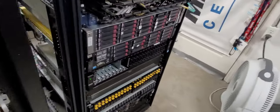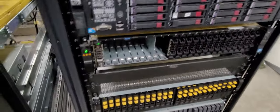Okay, now TrueNAS is rebooting. And at this stage, it's going to go through a lot of diagnostic states as its process. And that's perfectly okay, because what's going to happen is it's going to post the state of what I only allow it to see. Now, why did I do that? Because it's easiest to stage your disk arrays in increments as opposed to doing them as pre-configs. Now, if you've got a vendor out there who will pre-config them for you, that's great. But the reality is, we're poor guys and gals, so we can't do that.